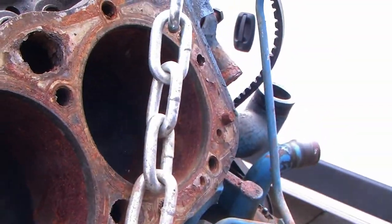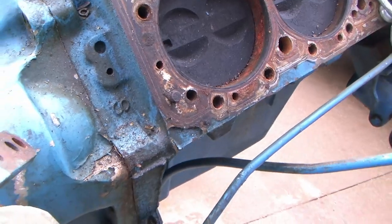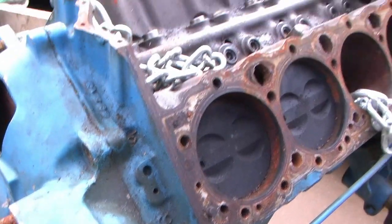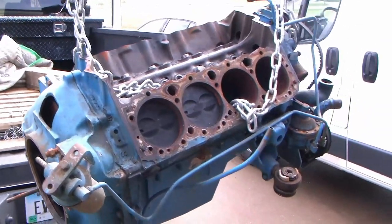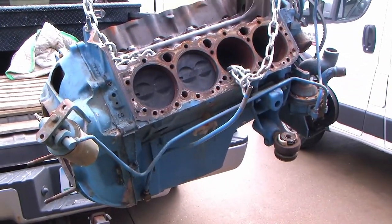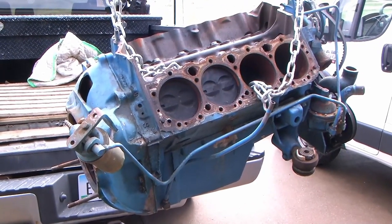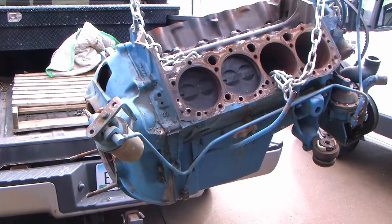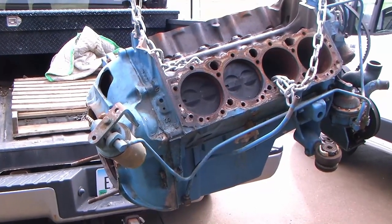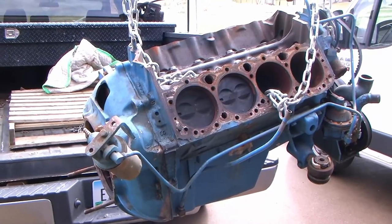As you can see, it's pretty rusted up. The cylinders in there are shot. We'll see if we can overhaul this engine or if I have to exchange it with a core charge. I don't have the heads for this motor — the heads were not with it. The previous owner had a mechanic pull the engine, obviously disassembled it, and the mechanic never got paid — I'm guessing he kept the heads as insurance.